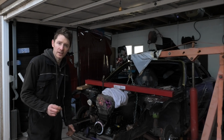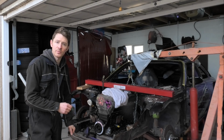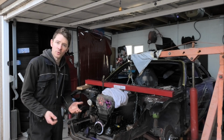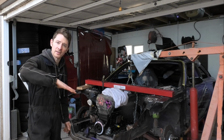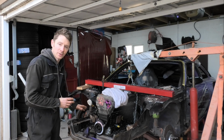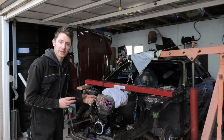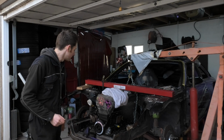Also, I want to get the right centralisation so that I can take the gearbox out without having to move the engine mounts. Before, with the old style engine mounts, I could loosen them, the engine kind of tipped back at the rear, and I could slide the gearbox off. With this, I don't want to have to move the engine, I just want to be able to slide the gearbox right off in case I have to get in the back to the clutch at a competition.